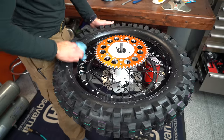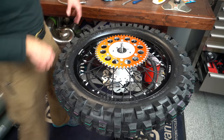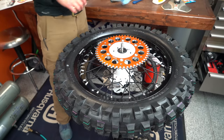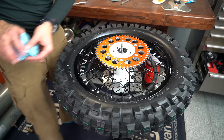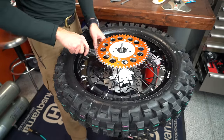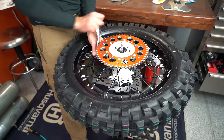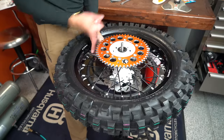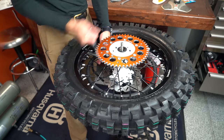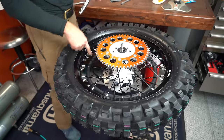Then I'm going to take my low pressure side. Notice I still have my rim lock not tightened. I'm going to put about 25 or 30 PSI in the low pressure chamber. Now I've got 30 PSI in that chamber — the bead popped all the way up. This is where the towels come in; I've got to wipe up a bunch of this Armor All that just popped out. That sucker has made a very good seal. I feel that Armor All helps make the tire seal because it just pops right up there. If you do have a problem where it's not sealing, a lot of times you'll have to take the tire all the way back off and start over — probably one out of every ten I do I'll have that problem, and usually it's because you've got a tear in the bead that isn't making perfect contact. So I'm just going to tighten this down. The rim lock doesn't need to be super uber tight because the high pressure air chamber itself is doing most of the work.